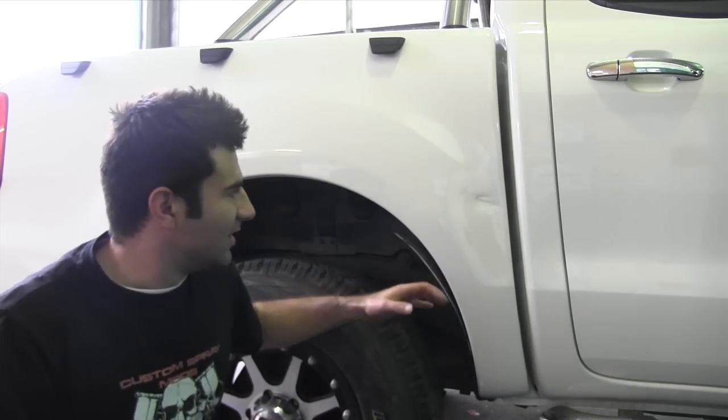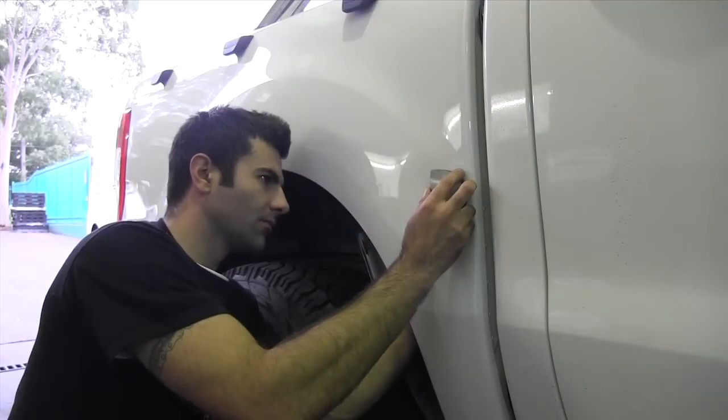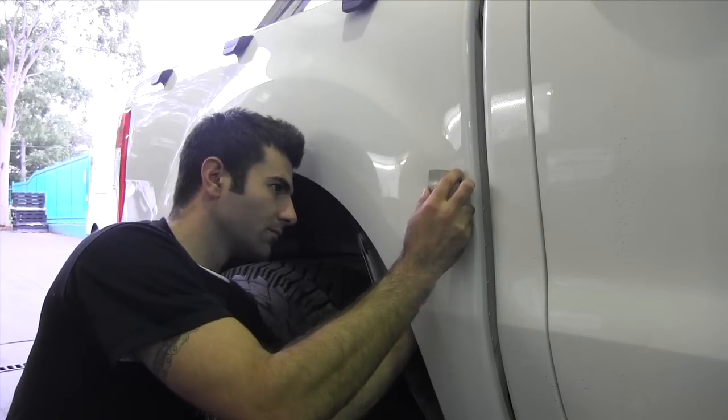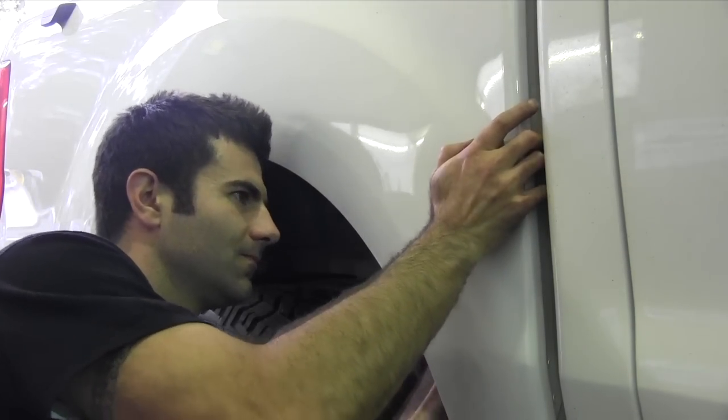So I've got this off, now I'm going to try and knock out that dent. The idea is to use as little filler as possible. By correcting that dent from behind, it means we use less body filler. The less body filler, the better the repair.